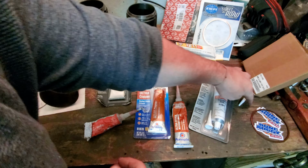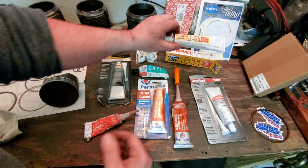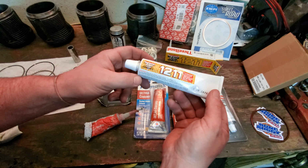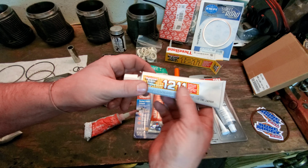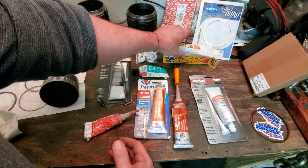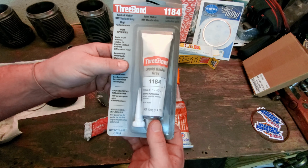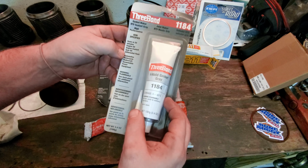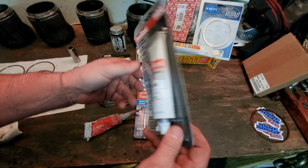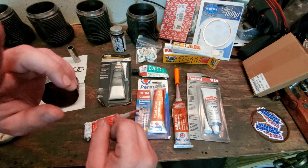This is a 1211. One of these is for silicone-based gasket, like this one right here. This one is supposed to be for, I think, let me see. This is the one that some people are using when it comes to sealing the case halves, the 1211. And then some people are using this one, the liquid gray, to seal the cylinders to the block. And I think that's because of the temperature specifications on it. They can handle the temps, and it's good for oil, right? So which one do you guys use? Comment below on the silicone choice that you go with.